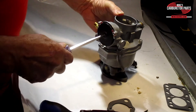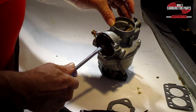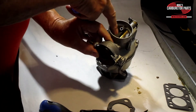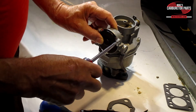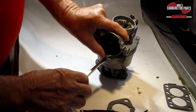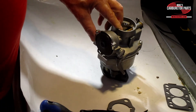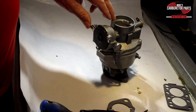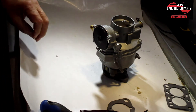Loosen up the choke a little bit, open the throttle up some so that the fast idle cam isn't holding up progress, and then twist this to the right — clockwise — just until the choke valve closes, and give it about another eighth of a turn or so. Then tighten it back up, and that's it for your choke. The choke will be closed when it's cold and all the way open when the engine is at operating temperature. If it's hard starting in the morning you think there's too much choke, loosen it a tad. If the choke isn't closing when it's cold, tighten it up a little bit — it's kind of trial and error.